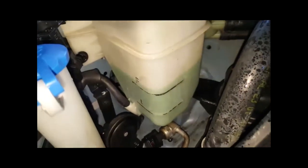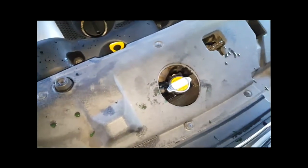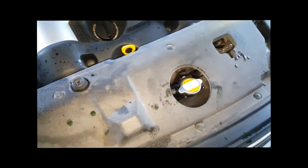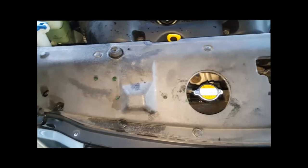We'll put it back together. Coolant's in — you can see on the reservoir there nice and clearly how full it is. Cap back on, and now I'll go in and run the car with the heaters on, give it a good cycle, probably about five minutes, and then I'll turn the car off and check the water level and top up if I need to.